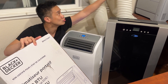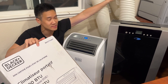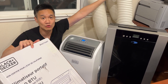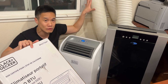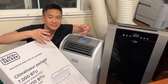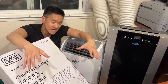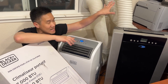This is 14,000 BTU dual hose and 12,000 BTU Black and Decker single hose. Which one is more efficient? Obviously the dual hose. But which one is better in terms of aesthetic? One hose looks better than dual hose because dual hose gets a little bit messy. In terms of efficiency, with the single hose it's just an exhaust, whereas the dual hose has an exhaust and an intake — the intake is fresh air that cools the inside. The single hose unit doesn't have an intake hose, so it takes air from your room to cool it, which means the air in your room gets depleted. More air seeps in from your windows or door gaps, making your room hotter because it's not getting outside air to cool the inside. That's why it's not as efficient, but it's easier to move around. The dual hose is a little bit harder to move around because you have to manipulate two hoses.